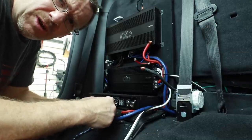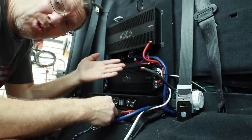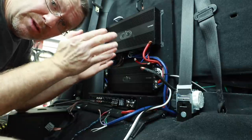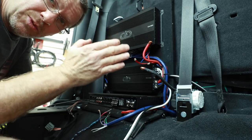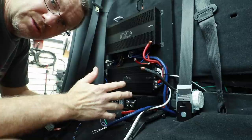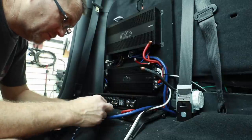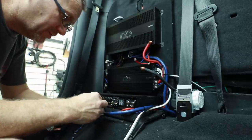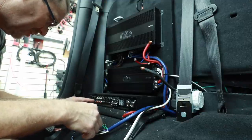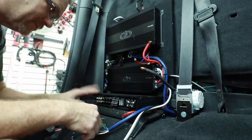For those of you going, what is bandpass? Bandpass means there's a low pass filter and a high pass filter combined. You want the mid-range to play between the frequencies of the mid bass and the tweeter — you need to limit its performance between those two points. A high and low pass crossover gives you that. I'm assuming these next two channels should be the tweeters. This one also has the ability to do a bandpass on channel one. It is on high pass, so that's good.